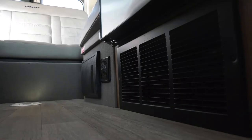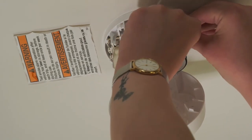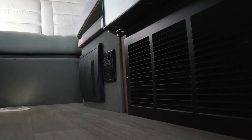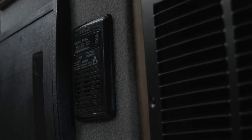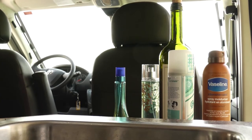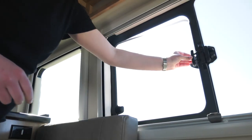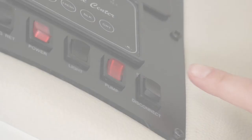Your vehicle is equipped with a smoke detector as well as a combination carbon monoxide and propane detector, and a fire extinguisher. The smoke detector is located on the ceiling and is powered by replaceable batteries — if the batteries need replacing, the detector will emit a periodic chirping sound. Replace batteries and keep the receipt for reimbursement. The combination carbon monoxide/propane detector is powered by the coach battery and warns with a fast chirping sound; it is located at the bottom of the wall close to the furnace vent. Note that the propane gas detector is sensitive to more than just propane — other combustibles detected include alcohol, colognes, perfumes, and most cleaning fluids. If the propane alarm sounds or you smell gas, shut off the gas supply, open all doors, and step away from the RV. Reset the detector by turning the battery disconnect switch to off for 15 seconds, then turn it back on.